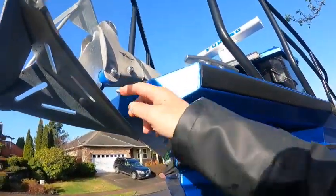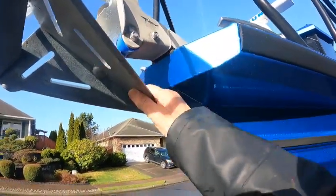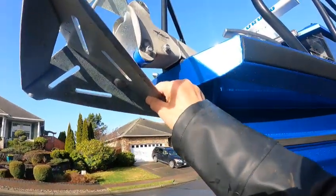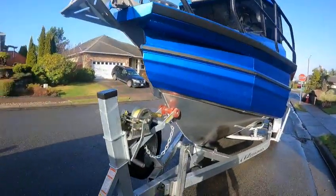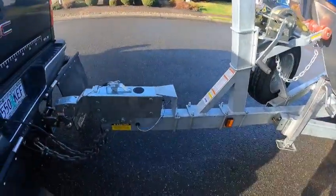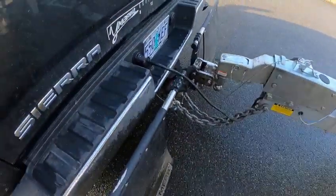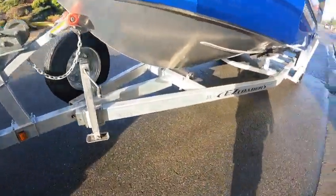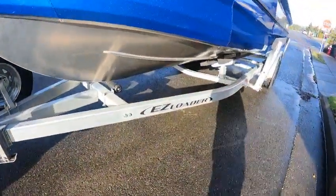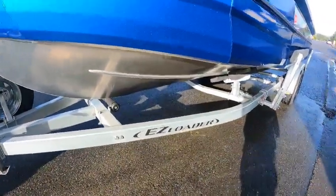You don't think much of that, and this here locked, it's like plow anchor, so that keeps us up nice and tight instead of wiggling around on you. Plus this will drop at an angle instead of you having to help pull it down. Got a 2-speed jack, heavy duty top mount coupler, 2 5/16 ball. Brake fluid I checked underneath the cap, round 7, heavy duty chains, foot jack I like, spare tire, keel roller. Again the boat can touch it, but you don't want to depend on that for the weight of the boat, or you just rip them rollers out real quick.